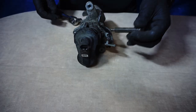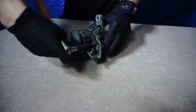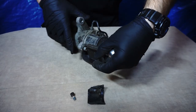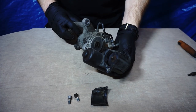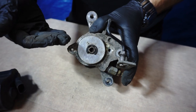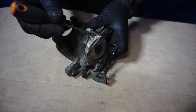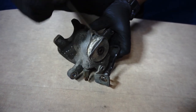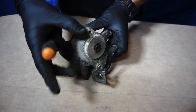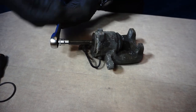Now we are about to show you the third way how to do it. Unscrew the two screws holding the housing of the EPB mechanism. Here we have a spline hole, match the correct torx and turn the handbrake mechanism shaft. It should retract or go further. Do you see this O-ring? Due to the oxidation of aluminum, the O-ring increased its outer diameter, pushing the EPB housing apart and causing it to crack. It will need to be cleaned very thoroughly. Okay, now turn the shaft.